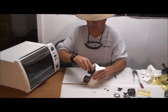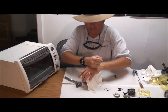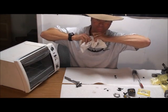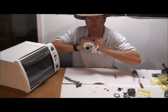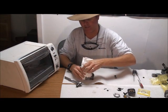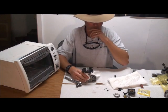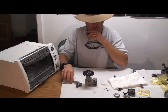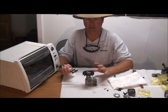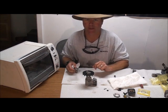Tighten it up. Now push down to get the top bearing seated, then grab the case and pull to get the back seated. You'll feel the front click — front seated — then pull and make sure the back is seated too. When you're done, you'll have a tiny bit of vertical play and you'll feel it click just a little bit — that means it's seated correctly. One thing I tend not to do: it's tempting to spin it right now to see how smooth it spins, but when the motor's still this hot with no lubrication, I tend not to do that. I'll let it sit and cool off before I work on the motor anymore.